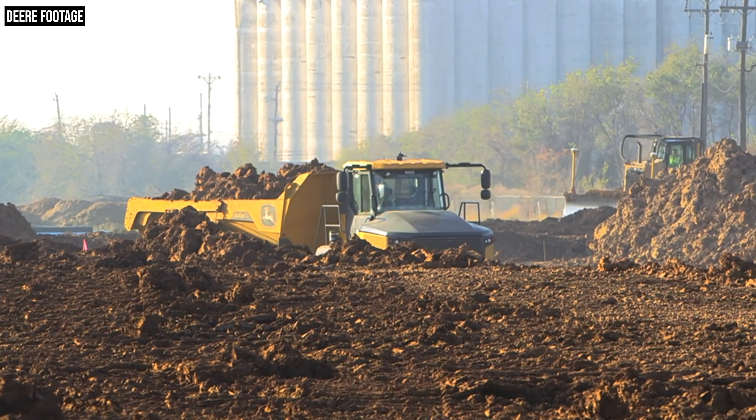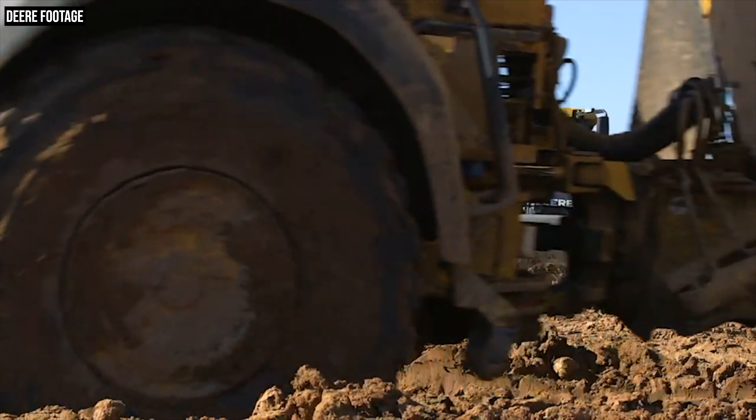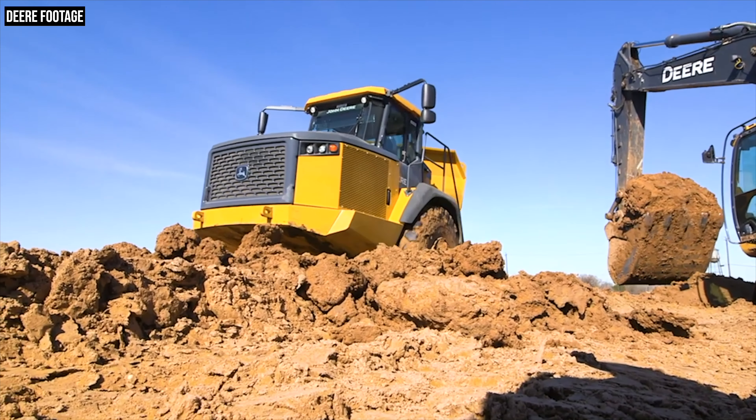The final of the three drive modes is traction mode. Whenever you're driving through soft terrain that's going to be a pain to navigate, you can switch into traction mode. First, the trucks lock into a first gear start. Then, once you're rolling, the trucks automatically sense when the differential locks need to be turned on — including both the interaxle differential locks, which lock the front to the mid to the rear, and the cross-axle locks — combining for true six-wheel drive in traction mode. The cool part is that while it automatically engages the differential locks, it still allows you to manually engage them when you need to.